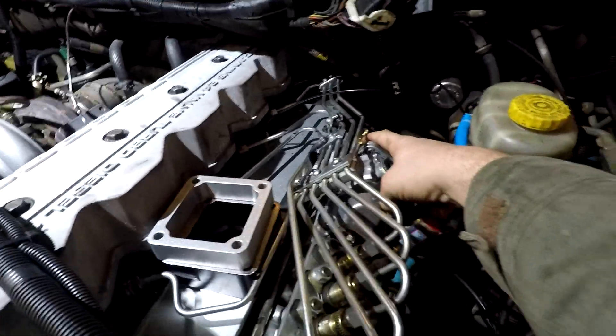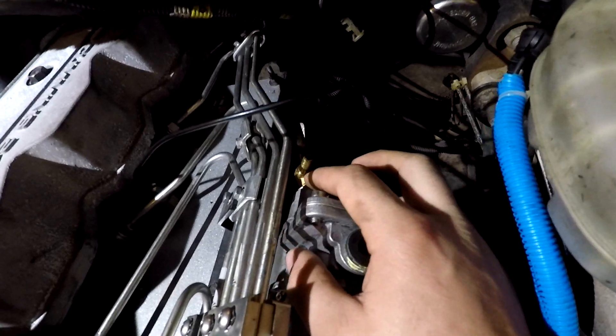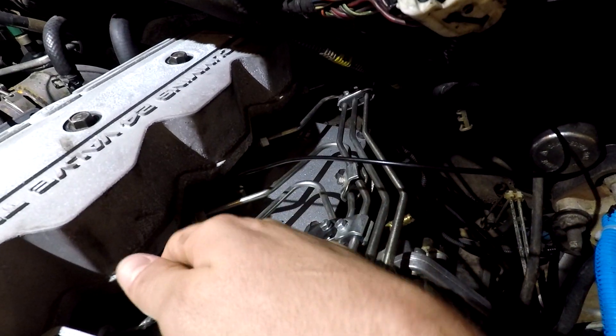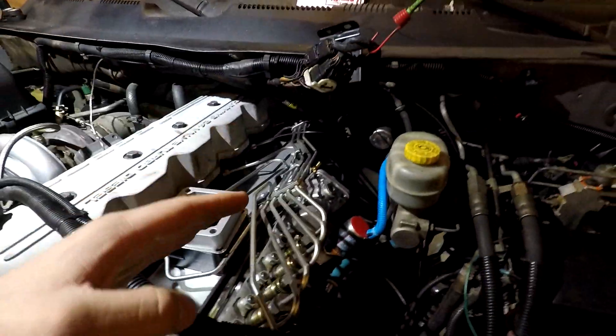One of the other things we have left to do is the AFC reference. We're gonna have a hose that comes out of the back of the AFC — you can see here — comes up and around and hooks up to the back of the injection pump. Once that is done, we'll get the intake put back on and get the intercooler piping put back in place.